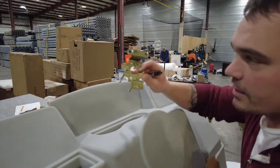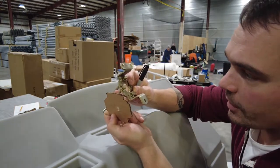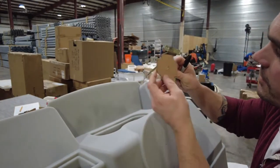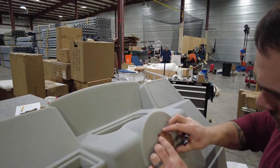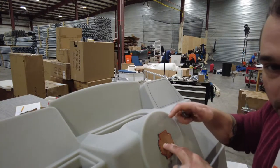Not every time, but most times your bracket is going to look like this — there's a brass piece and then your helm comes up through and embeds down in. There is a center hole. I've got a little cutout mocked up to be the same size as this. I'm just going to center it on that hole as square as I can and then trace it.